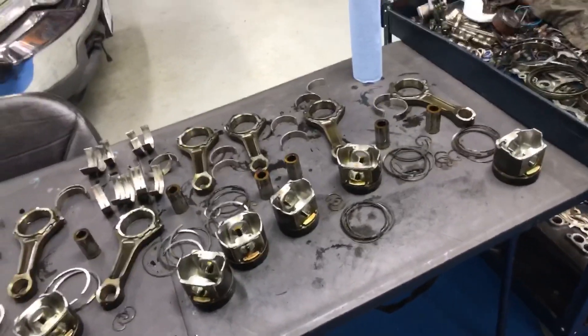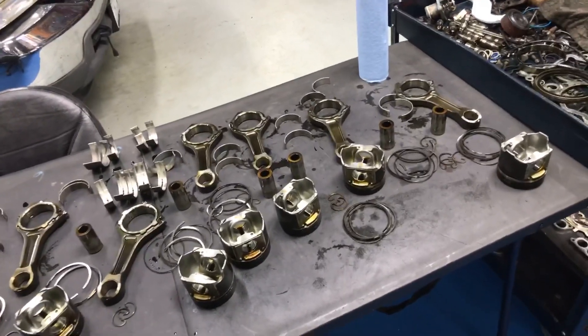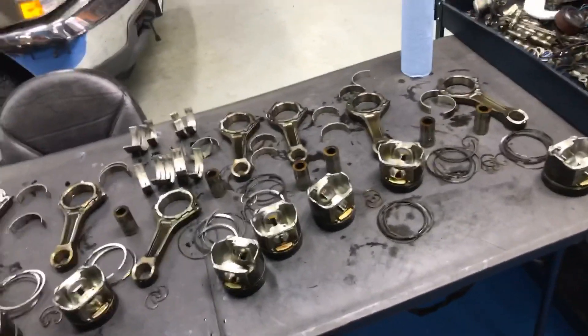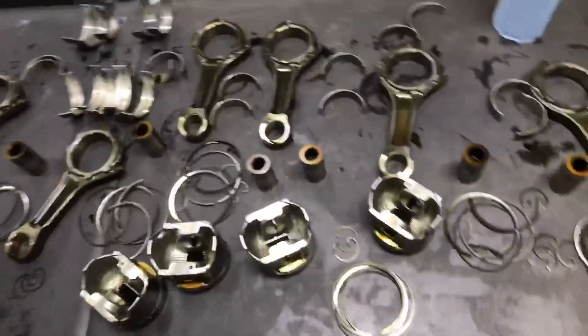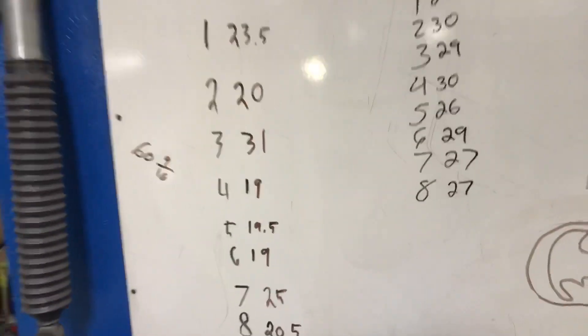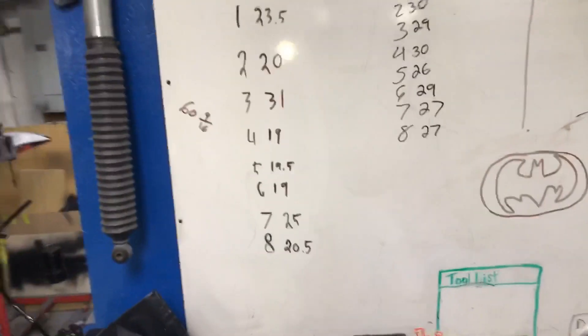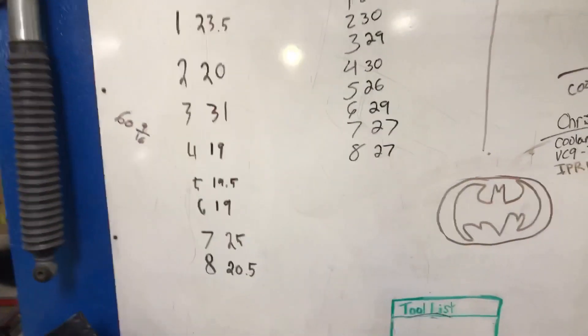I think it's going to take 20-over — we'll see. One of them was about 13 on the bore gauge when we were just kind of ghetto-checking it before we cut. The bushings — none of the bushings look spun in the rods, they're all holding intact. The big concern I have with those rods is protrusion. Protrusion is absolutely crazy — we've got 31 to 19 now.